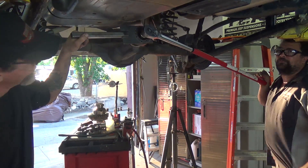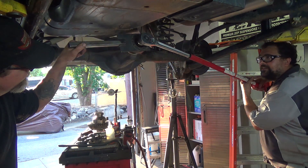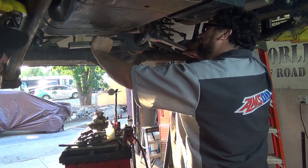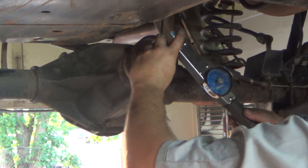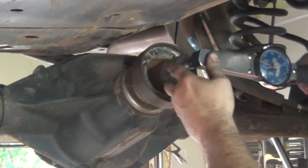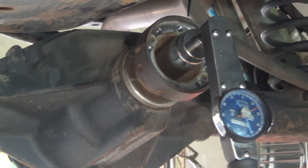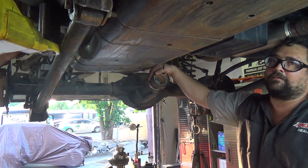What we're going for is moving this the absolute smallest amount possible, which is hard to do at the end of a bar on this wall — and it's also hard to get it to move at all, it's really getting tight. It moved just a little bit. Let's check it — the moment of truth. We're at 24 inch-pounds, 23-24. The spec is 22 to 35, so we're just within spec. We're not going to monkey with this any further — we'll leave it be. You can feel there is some tension here.